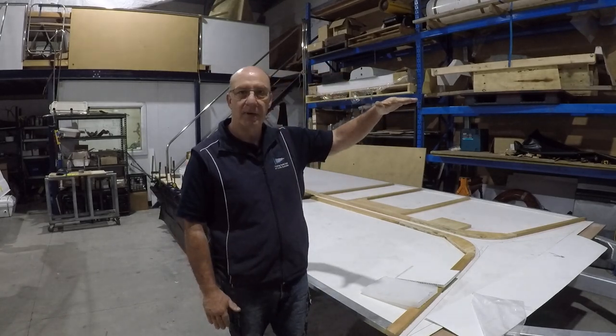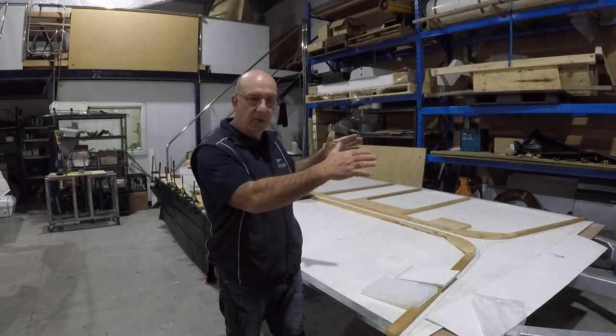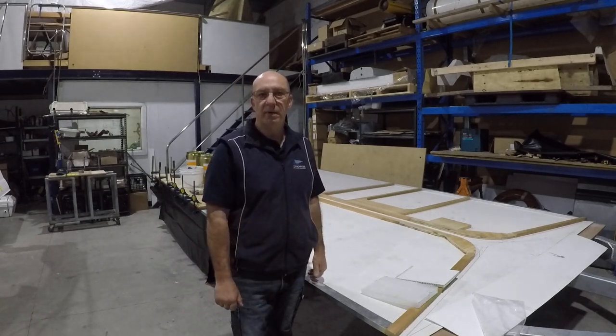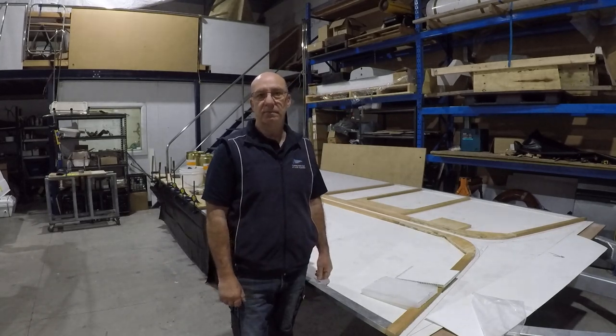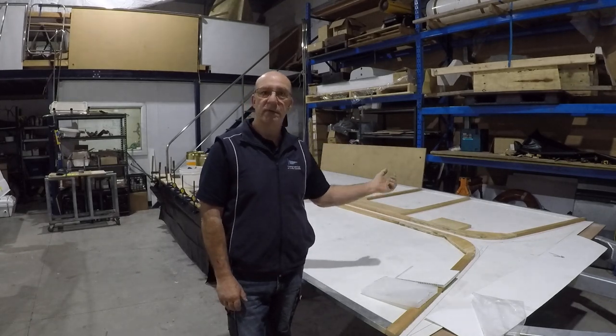From the chassis up, from around about 800mm up, there will be an aluminium framework going right around the perimeter of the van, with some 1.6mm or 2mm aluminium checkerplate on the sides. On top of that there will be some fiberglass honeycomb composite panels that will basically make the side walls, the end walls and the roof.